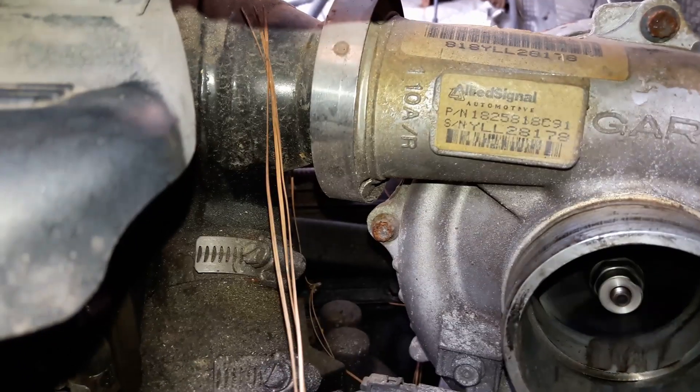You need to spin it and check it and make sure that it spins easy and continues to spin evenly — like there isn't a point where it spins and then all of a sudden it locks up. It spins evenly and spins down evenly and everything is kind of smooth. That's a pretty easy way to check a turbo out. I hope you enjoyed this video. Please like and subscribe, hit the bell for notifications so you get the videos as they come out and are released. Thanks, have a great day.